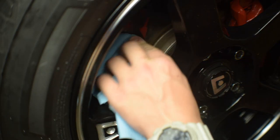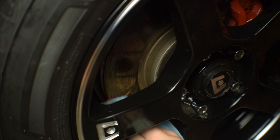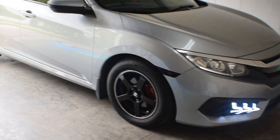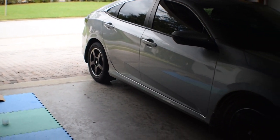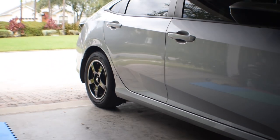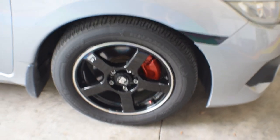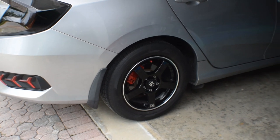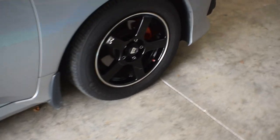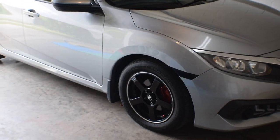As you can see here, I got a little bit of overspray onto the rotors, so I just poured a little bit of acetone onto a rag and wiped it off — comes right off clean. So if you have any lacquer, acetone, or paint remover, just put some on a rag and wipe off the overspray. Very satisfied with the end result. Overall the process took me roughly three hours to paint all four at the same time. The main part you have to wait for is just the paint to dry — you don't want to paint too soon, so make sure you wait and let it dry between coats and it'll turn out really nice like this. You can do this on any car — in particular I'm doing this on a 10th gen Civic. If you guys learned something, smash the like button. I'm going to be doing some more upgrades and a chrome delete on the next video, so feel free to subscribe and follow the journey. Appreciate you guys.